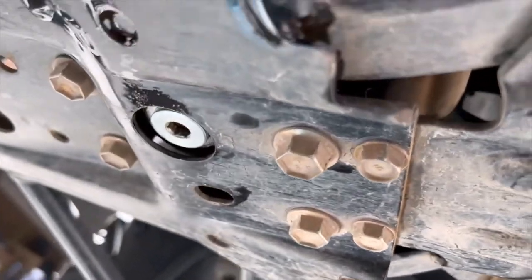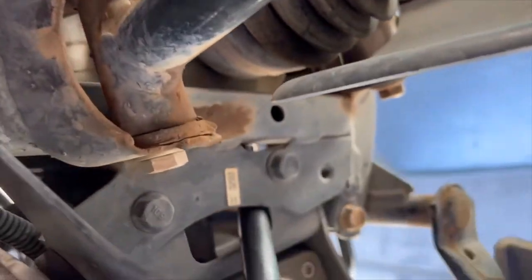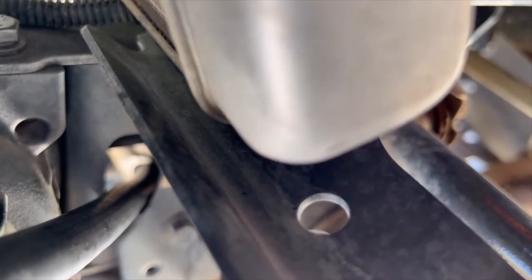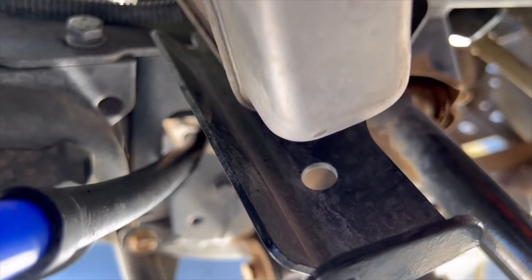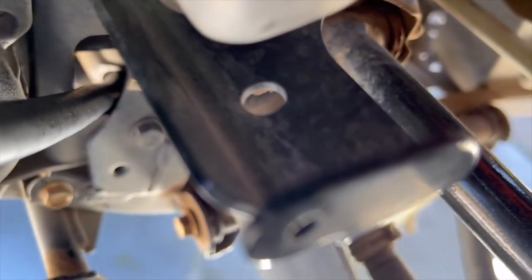For the front differential, we've got it drained already and cleaned off — 8mm allen again. The fill port is a real pain; it's way down in there. It's very hard to get to because he has a winch on it — without the winch it'd be easy. This takes 255 milliliters, which is 9 ounces. We're going to use a graduated cylinder, pour out 255ml, then put it down the funnel right into the front differential.